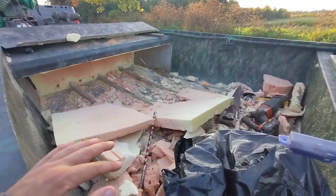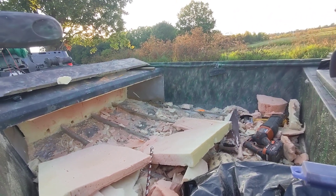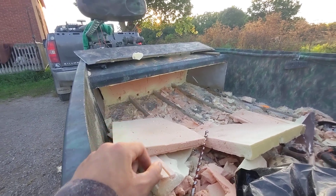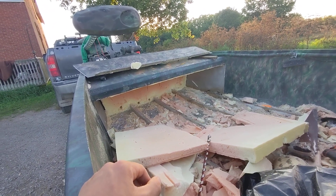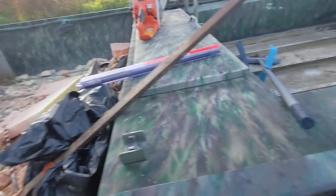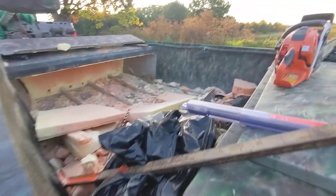I've read in a few forums about guys putting styrofoam in the bottom of the boat because it's cheap, easy, and available. They say they've never spilled fuel in their boat, so they don't see why not. But I can tell you that the foam in the bottom of my boat - despite not remembering spilling fuel - reeks like fuel. That fuel must have gotten in there at some point, maybe last year. That foam doesn't let go of water or fuel. I would highly recommend not putting styrofoam in, especially in the floor, because it will also disintegrate on you.